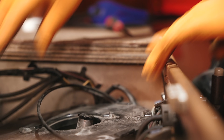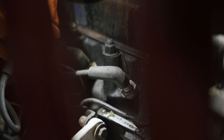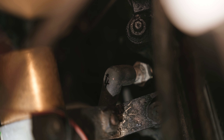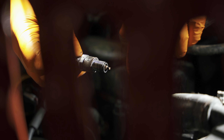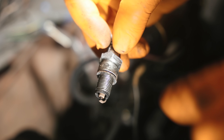The next thing to check is the spark plugs. I've got no idea when they were last changed or even checked. The first thing I'm going to do is mark each of the leads so I don't get them confused. The first plug is a warm straw colour — nice light brown — and that's looking like a good little burn. I have to check the gap, but that's all right.